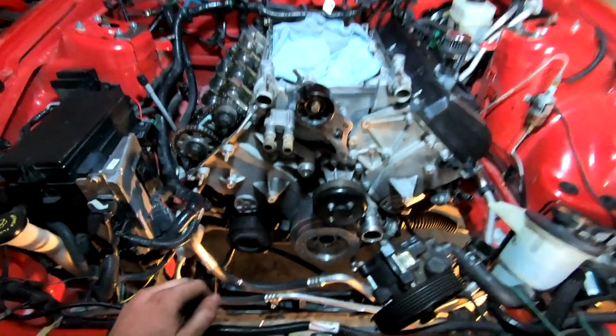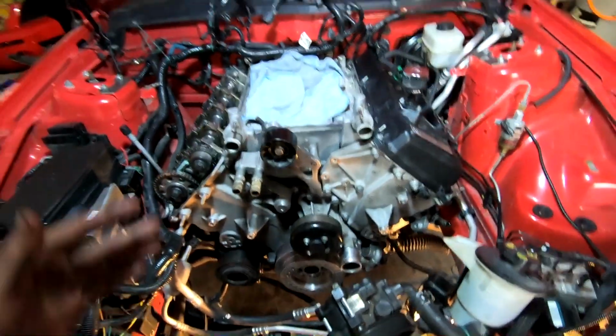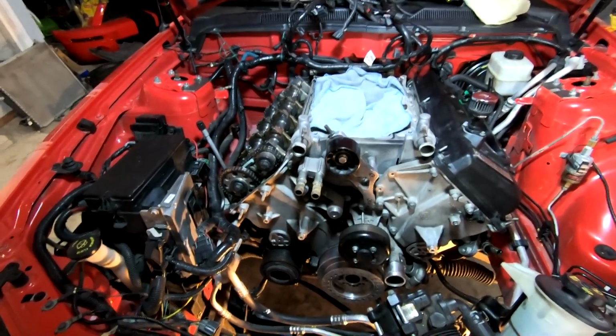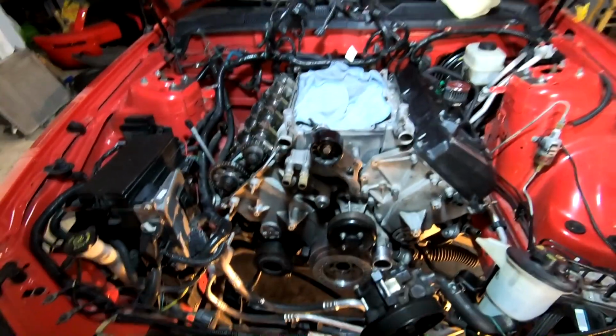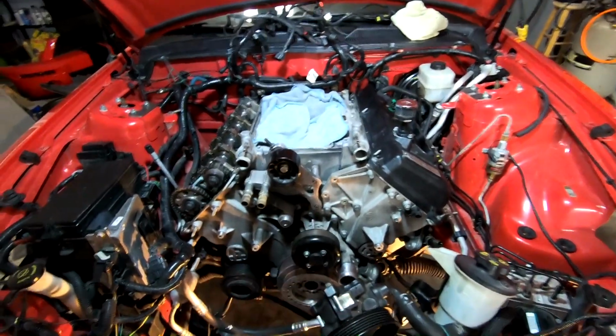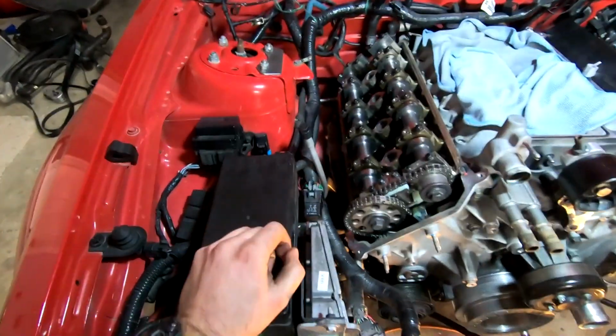All right, oil pan bolts are buttoned up to 18 foot-pounds. Exhaust is back on, that's buttoned up. Definitely feeling more motivation than I was taking this whole thing apart, I'll say that for sure. So let's go ahead and get our valve cover on, and then we can also bolt down our motor mounts. And well, just keep on going.